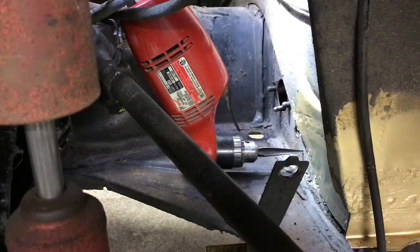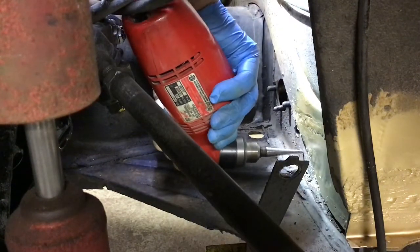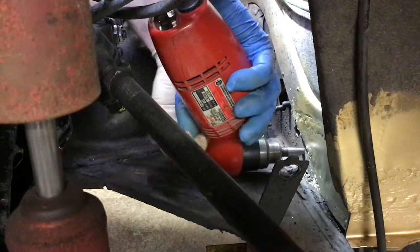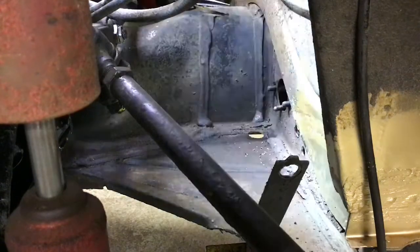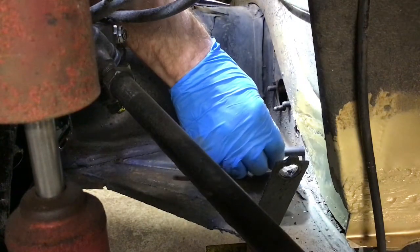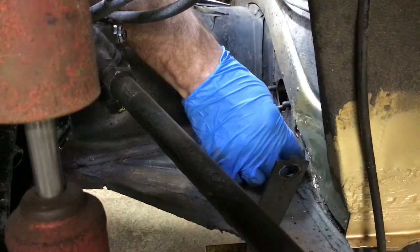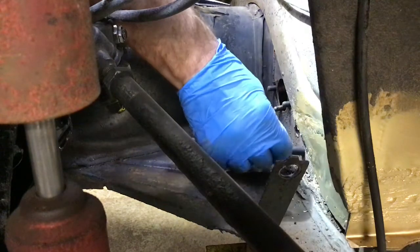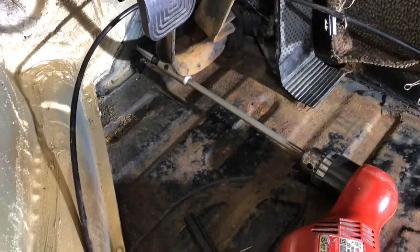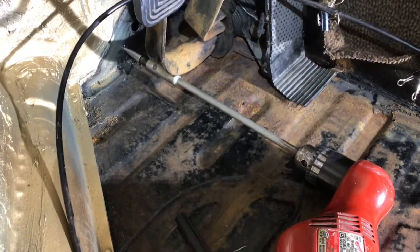With the master out of the way, I'm going to drill a hole for the new fuel line where it runs in — everything is clear over here. I'll get a step drill and drill a hole. The line is going to be a quarter inch, but I'm going to sleeve it with a piece of rubber hose to keep the line from jiggling around. The beauty of the step drill is it already drilled the hole partially on the other side, so I drilled it from the opposite direction. The pedal was in the way so I needed an extension on the drill bit.